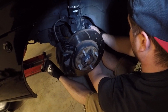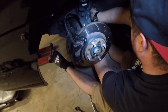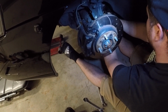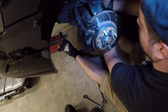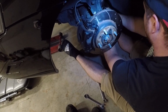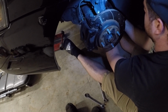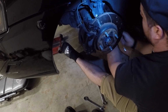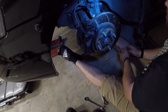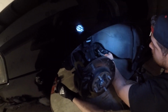Yeah, I see it turning in now. Damn, what a difference. Hopefully it doesn't bottom out. So now you can turn the wheel straight, or put the wheel straight. Basically, I can make the wheels drive straight and keep the wheels straight. Makes sense, because I off-centered the rack before I put it back in. But now we got that fixed.